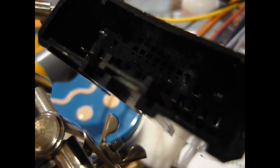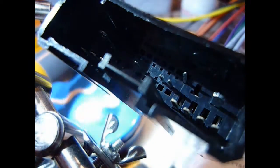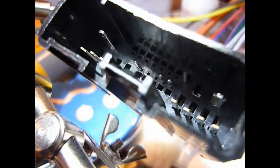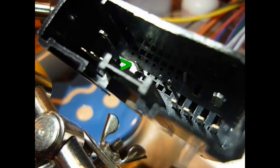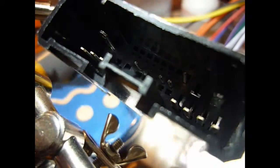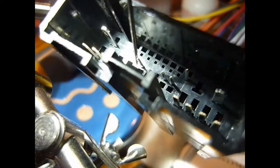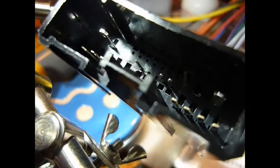I'm going to show you how to modify the D5102 harness to allow for illumination. What we need to do is find the blue wire here — it's on pin number 12 on my diagram on the wiki. It's this pin right here, the one in the group by itself.